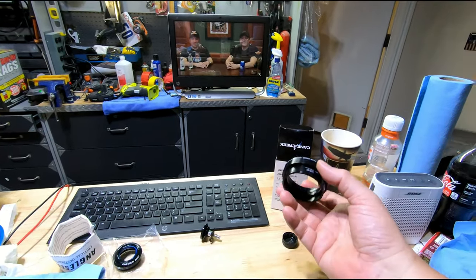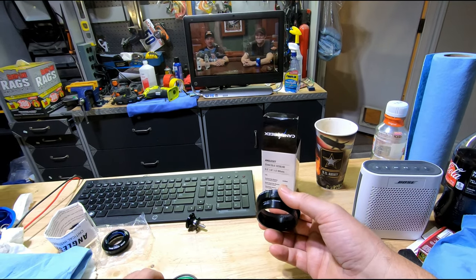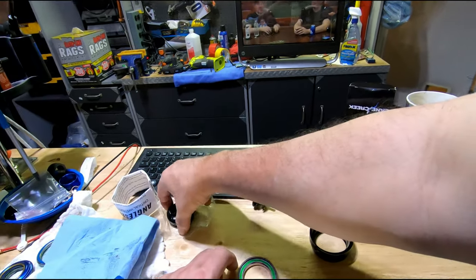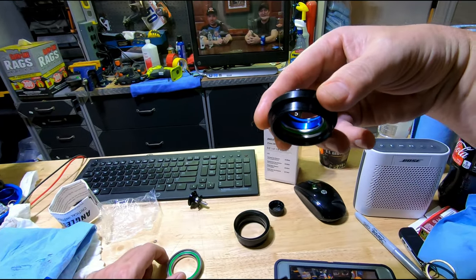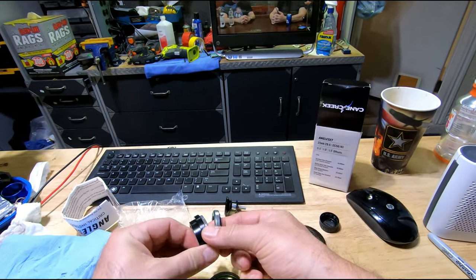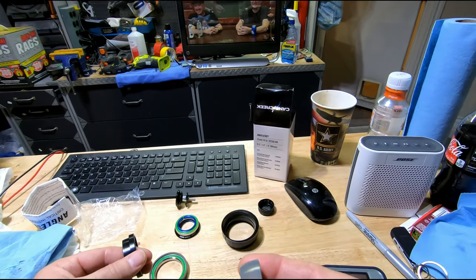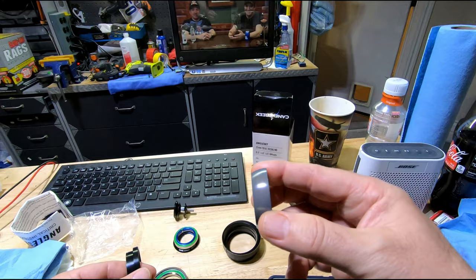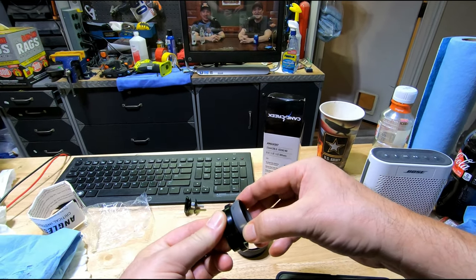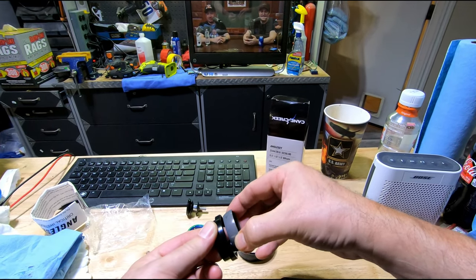And there's three cups. You got a zero, a point... No, take that back. You have a 0.5, a 1.0, and a 1.5 degree offset. And I'm choosing the 1.5 degree. The upper headset is neutral. It's 0 degree, but it does have a bevel cup, so it allows the cup to coincide with the lower, whatever degree that is set, it moves.